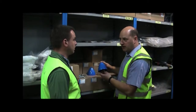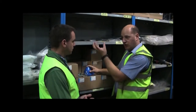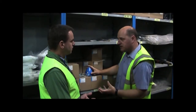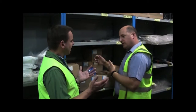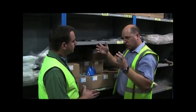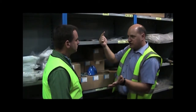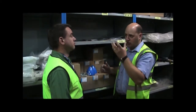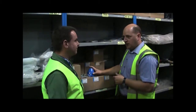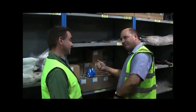Here's a new product that you won't have seen. It's called a reverse or inverse relocation cone. You're familiar with the top-mounted relocation cones for dislocating suspension, which allows the spring to go back up and align with its perch properly as opposed to coming out and rubbing on the inside of the tire. Why would we want to do that on the bottom? Well, on extreme long-travel suspension, the spring angles so much when the axle is fully tipped over — one wheel stuffs right up into the wheel arch and the other drops right out. Sometimes the spring can go outside of a conventional top-mounted relocation cone, and the spring jams off to the side. With most high-lift jacks being four feet, they won't even lift the car high enough to relocate the spring, so you've got to find somewhere off-road to get the spring back.